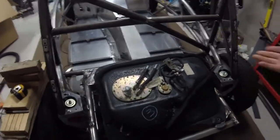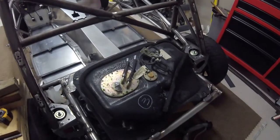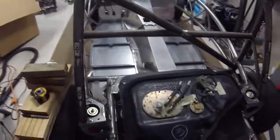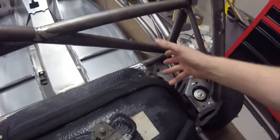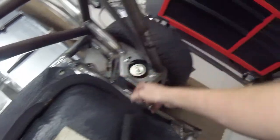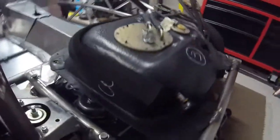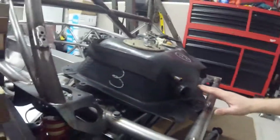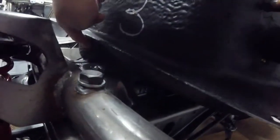With the fuel cell from the Miata I've decided I'm not going to reverse mount it as I was thinking, because the filler neck being here with the wing just isn't in an appropriate spot and there's not enough room to bring the hose around through the inside of the bodywork. So I'm going to mount it the standard way. The one important thing when you mount this is you want to make sure it is higher in the rear than in the front.